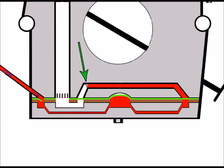I have come across many situations where the blockage can't be removed doing this, and a common thing nowadays is to use an ultrasonic cleaner that can loosen the dirt first, so you could have that option also. In the past with stubborn blockages, I have put them in boiling water and soap and left them in there for a few minutes, maybe 5 minutes. And then I've had another go with the airline, and sometimes the blockage is removed.